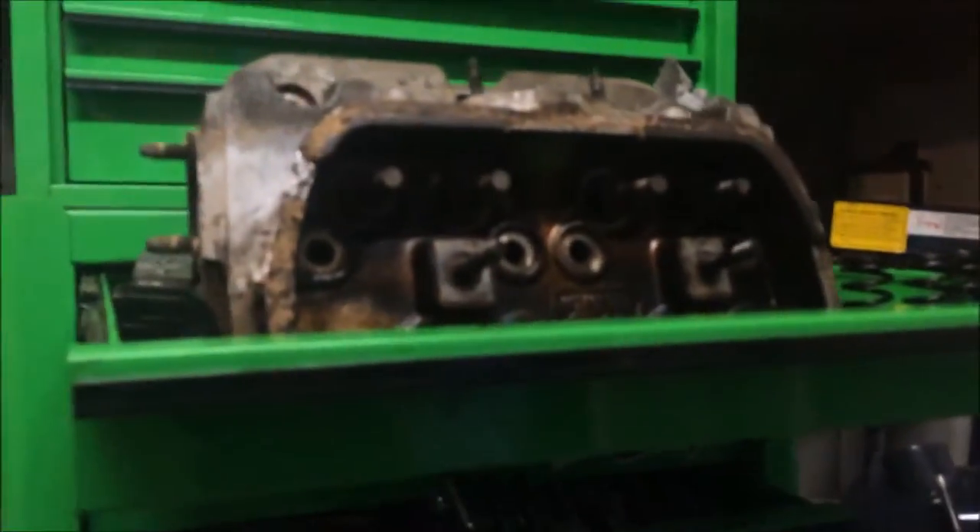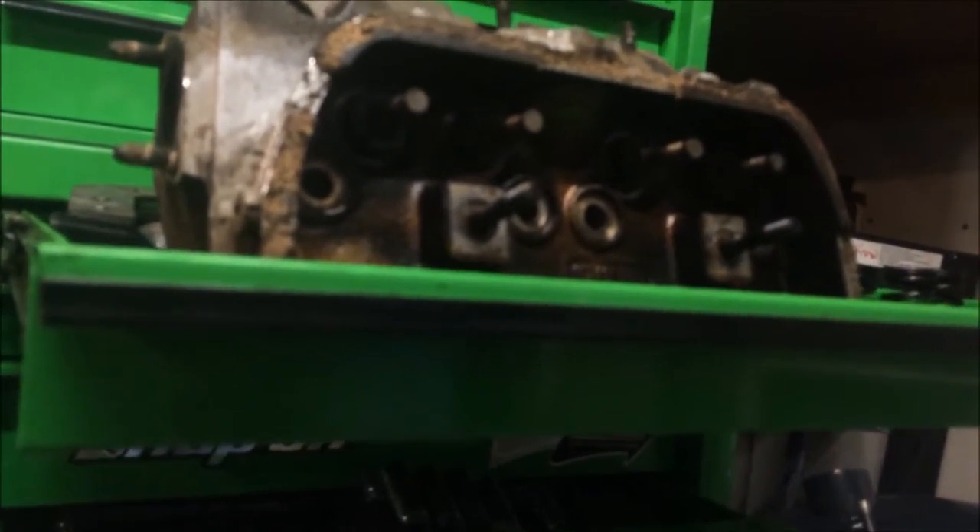There is a lot of movement there. I can't remember - my dad had this redone when he bought the Beetle back in 2005. He had the engine stripped apart and anything needed was done. I think he put new bearings in it and possibly new guides in the head and new valves. But on some of the exhaust valves they look like they're elongated, which I think is about right because you've got to set them up and ream them when you put them in again.